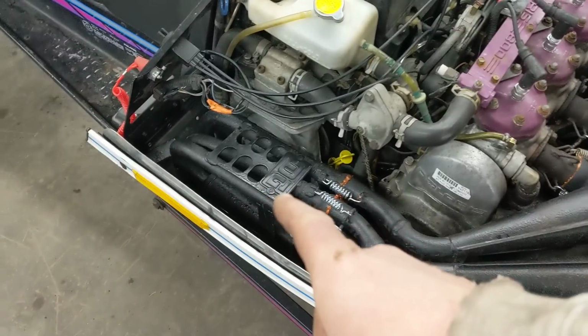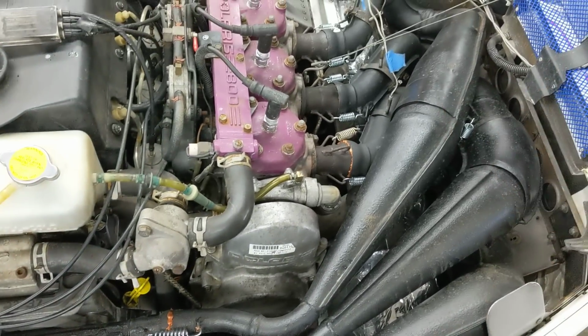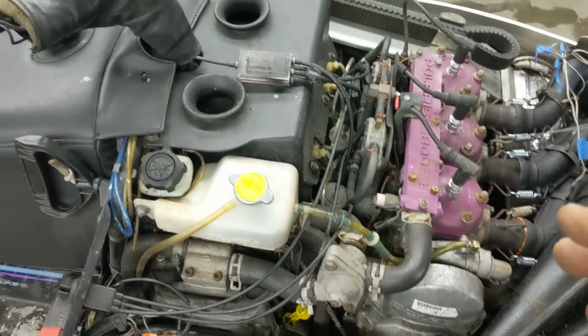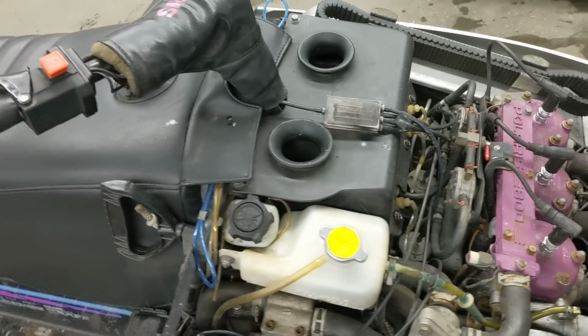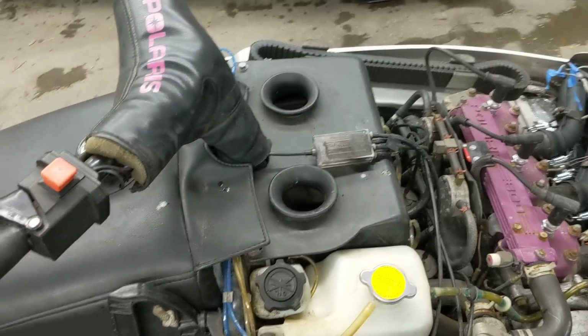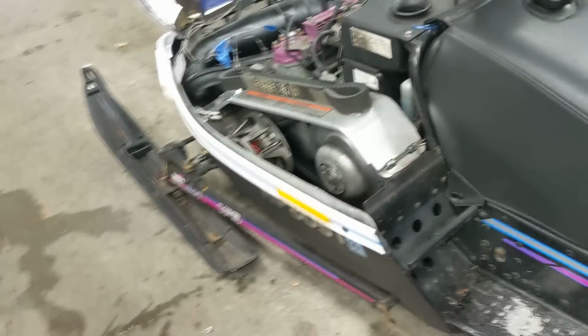So he put the DG silencer on here, and same thing. He sealed all of his pipes up, all new springs everywhere to keep everything nice and tight. Cleaned his carbs. He did a little jetting also. We just went one jet down from stock, basically. And he's got EGTs on his, so he can keep an eye on his exhaust temperatures. And so we just went through general maintenance again, chain case, oil, stuff like that. Didn't get too crazy, did some vent lines replacing on it and stuff.